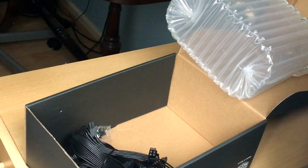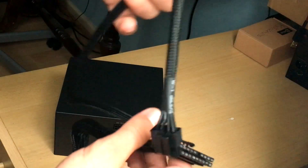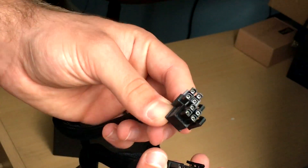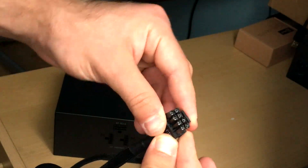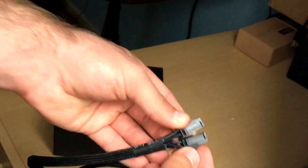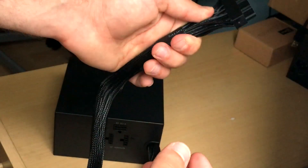So as I was saying, these two connectors are attached — you can't take them out, they're part of the power supply itself, hence called semi-modular. Here's your CPU power pin — it's four plus four, so you can use either just the four pin or connect both halves for eight pin, it doesn't really matter. You just plug them in normally and it'll be fine. And here's the 24 pin connector for the motherboard.